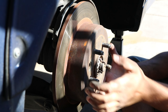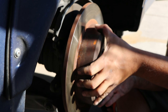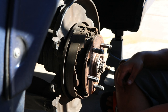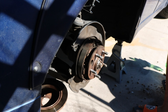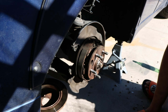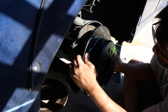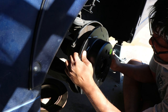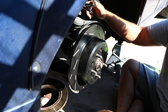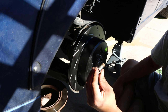Parking brake is on — let me take that off. I've already wiped down this new rotor to make sure there's no residue left on it. The next step is to pop this head right on here, just like so. Then I'm going to bolt the caliper back in, put some Loctite on these nuts, and tighten to about 77 foot pounds of torque.